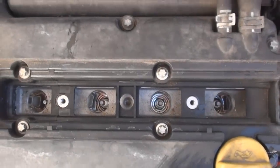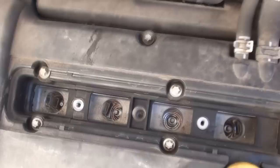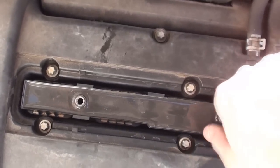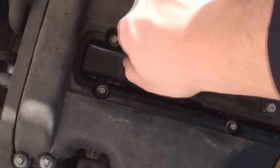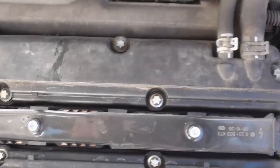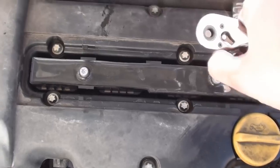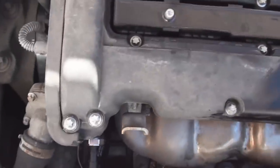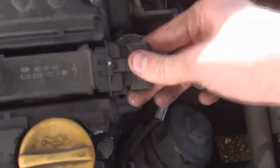So they're all in. I'm going to put the coil pack back in now, then tighten that up as well. Coil pack in — that's nice and easy. Line up the bolts, then you just need the T30 bit again. Don't drop it like I did. Tighten the last one up. Connect on at the end, put the cover back on which slides across.